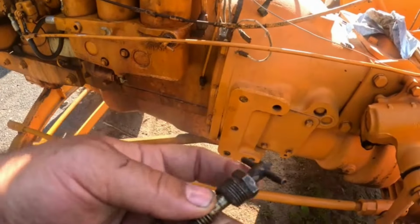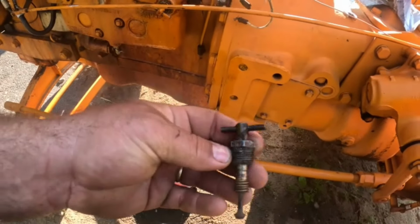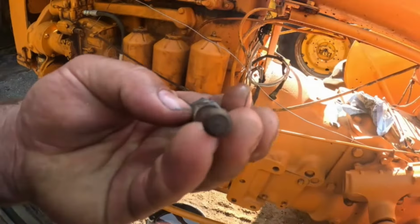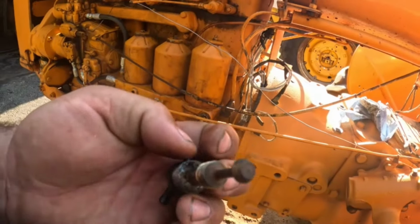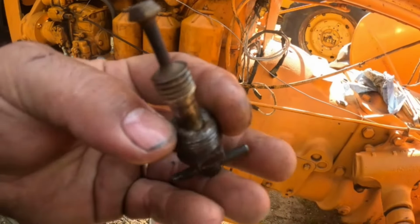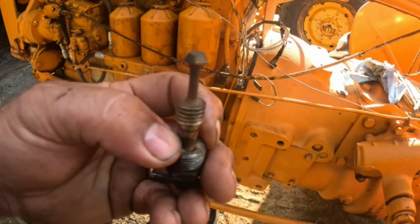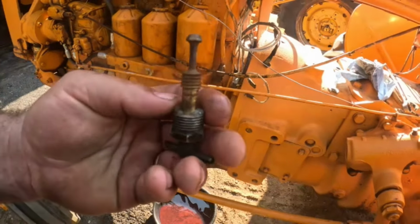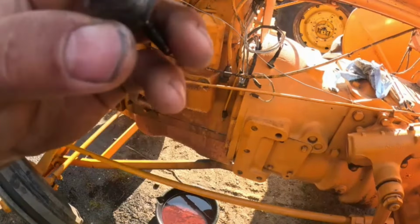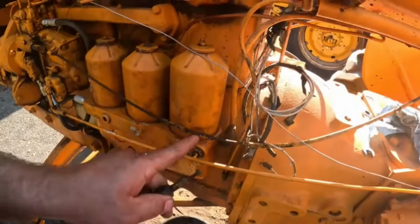This is the shutoff valve off that UTS diesel, which I'm gonna put back in, but just for reference purposes. This right here, I come to figure out, is some kind of rope packing that they used to use to seal up threads and leaks and whatever. So I think I'm gonna do the same thing with Teflon tape. I'm gonna try it. I hope, maybe, wrap it around there, but I'm gonna try to use this one.